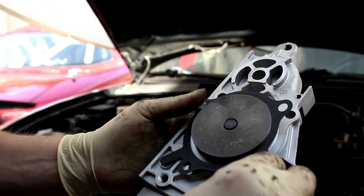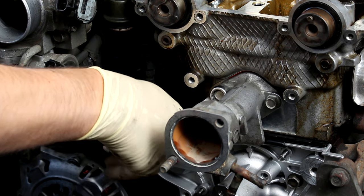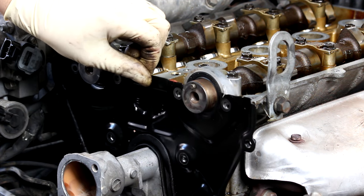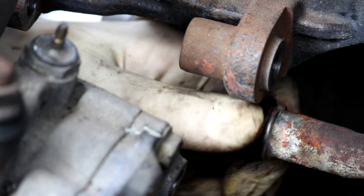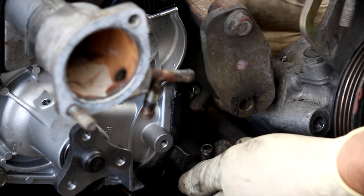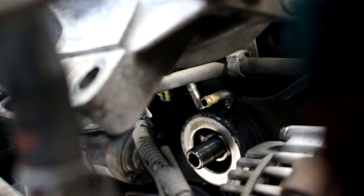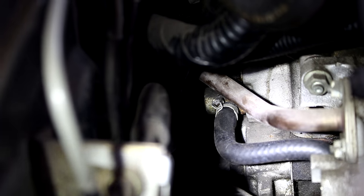The water pump can go back on. I'm using an OEM Mazda gasket that came with the Treasure Coast kit. I did not have an O-ring here, so I used RTV where the O-ring would go. Don't forget to put your timing back plate on before you install your cam gears. Then put the new O-ring back on the heater core hard pipe, put the mixing manifold onto that O-ring, slip the gasket into place, get the bolts started, and once those are started it'll be easy to tighten them down. The coolant hoses on the side of the engine are pretty intuitive based on their shape — just slip them onto the ports and tighten them down.